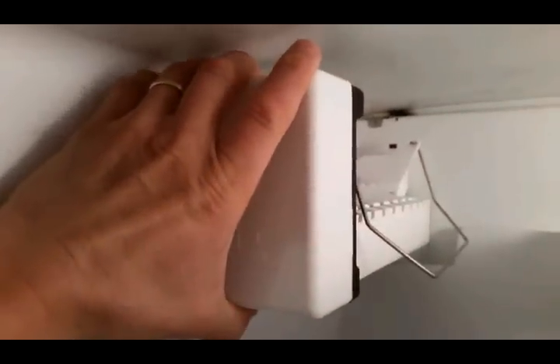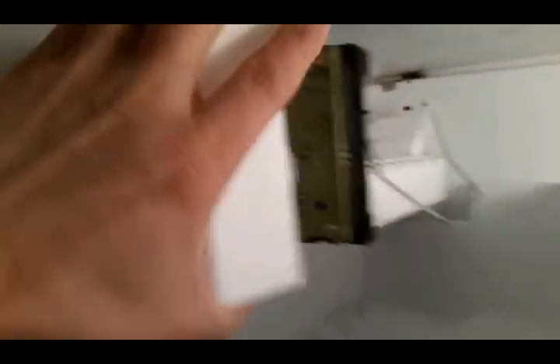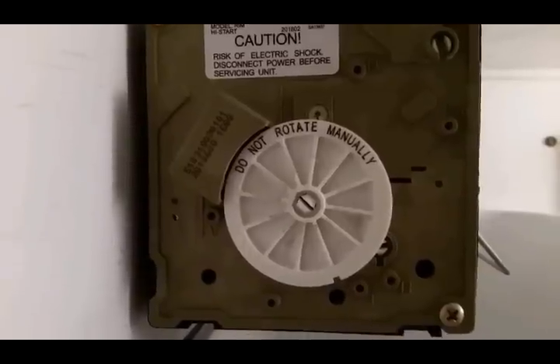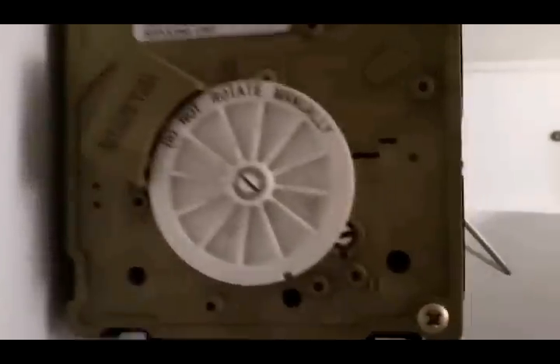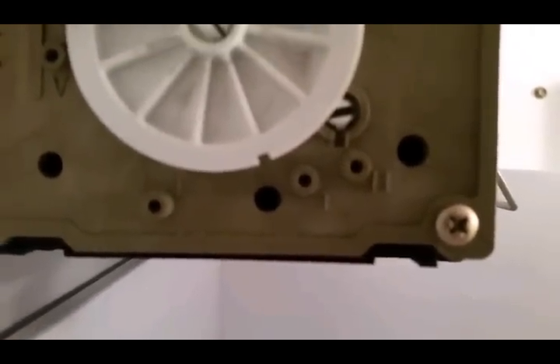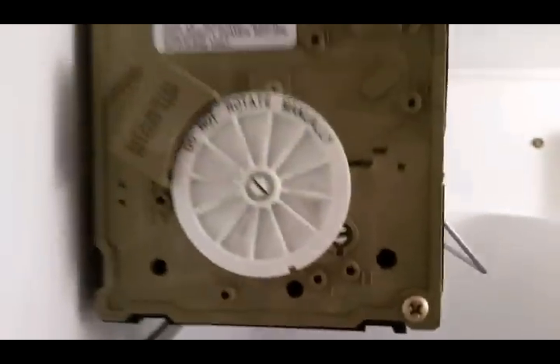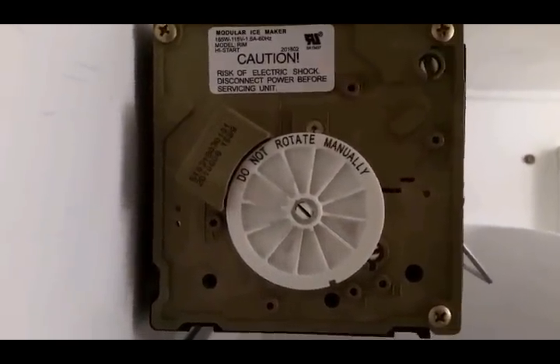In my case, I've got ice and I know it's hard, so we're actually going to see ice fall. What you want to do is remove that cover. I only advise that you do this if your ice maker matches this unit. But if you look at the bottom, there are holes marked T and H. You can use those to test the entire cycle of the ice maker and run through all of its motions.